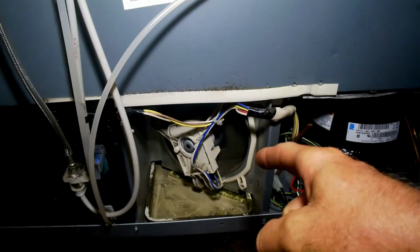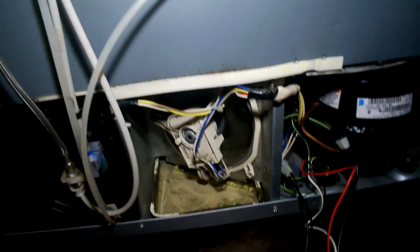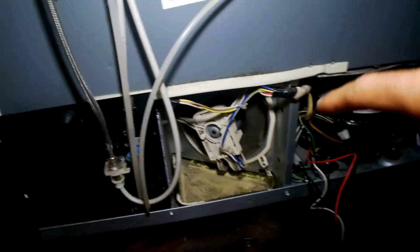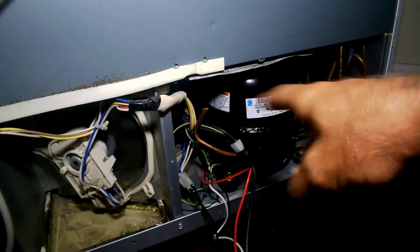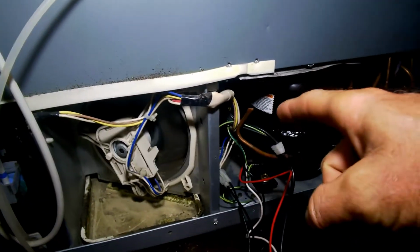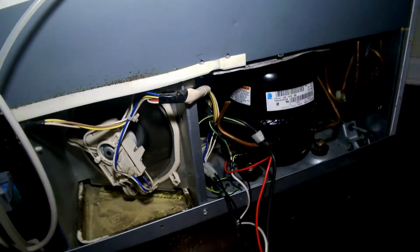And this front portion here, see, air needs to draw through there because there's this exhaust fan back here, and it's pulling air this way, sucking it through the front of the fridge, cooling off those condenser coils back there. And mine were real thick, crazy, super covered in dust and whatnot. So things started overheating when those things are caked up like that. They're not dispersing heat like they need to.